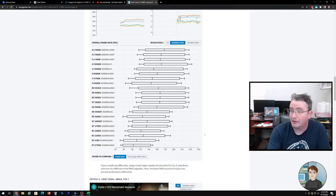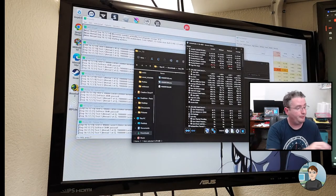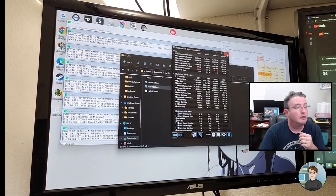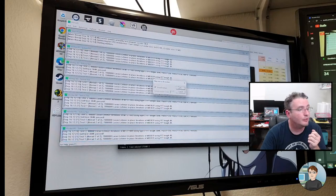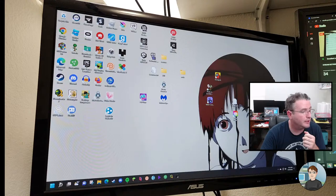Well, I'll tell you what, we'll try it. If it's still blue screens, we can knock it down to 3200 megahertz and call it a day. Yeah, it looks like it maxed out at 82 degrees C, which is fine. All right, back here. There we go, okay. Let's just try it. Closing out. Stopping Prime95. And let's reboot and turn it back on.